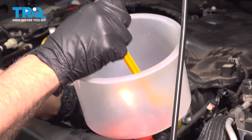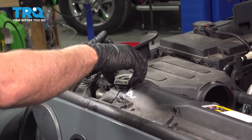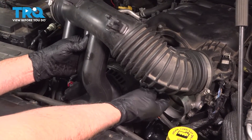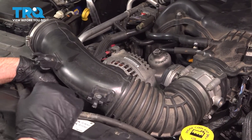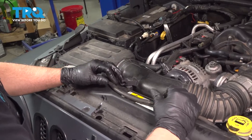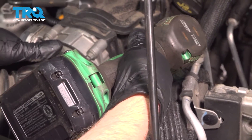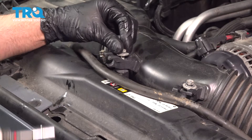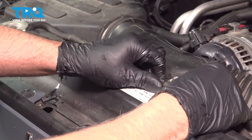I'm just gonna put a little extra in the overflow. The coolant's all the way up to the top of the radiator. Now we'll just put the radiator cap on, close that off, and plug this in underneath — lock that down. Line it up, go over the throttle body, onto the air box. Snug down the clamps. Get these two screws started and snug those down. Slide the hose into the retainer.